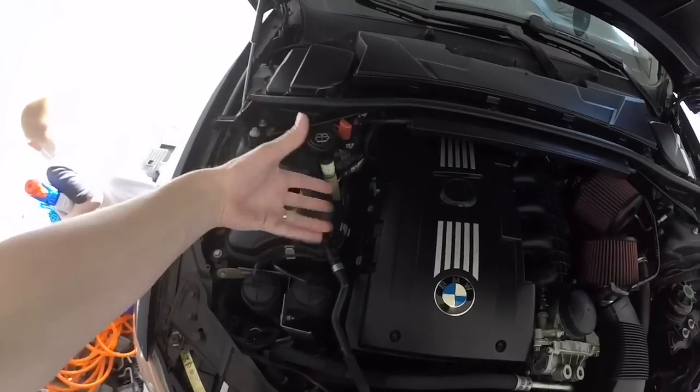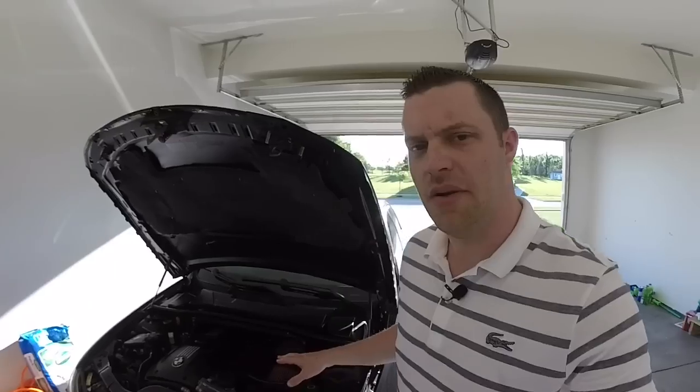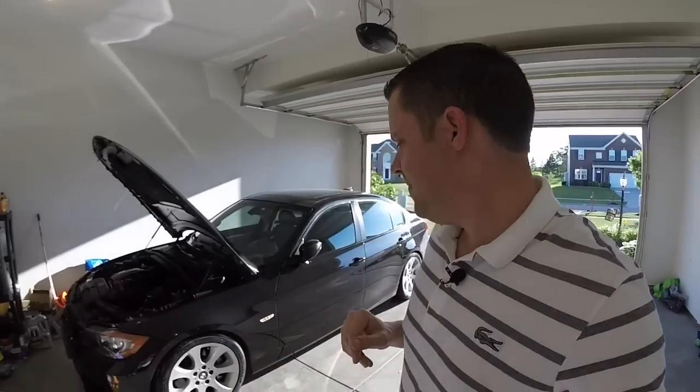If you have large play back and forth, that's more of a concern. Once you've checked everything underneath the hood, remember you are still going to do a pre-purchase inspection — it looks a lot further than what you're doing right now. You can also feel around the gasket and look around the valve cover; you'll see oil pooling there if your valve cover gasket is leaking. Bring a flashlight to shine down the front and check for oil leaks; the belly pan will hide a lot of oil and coolant.